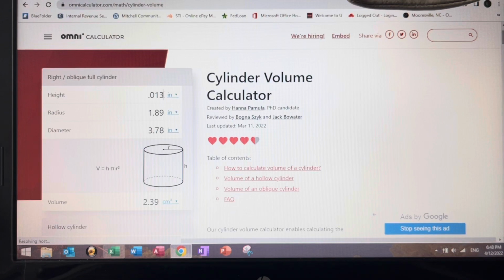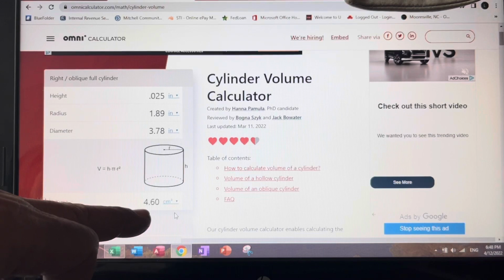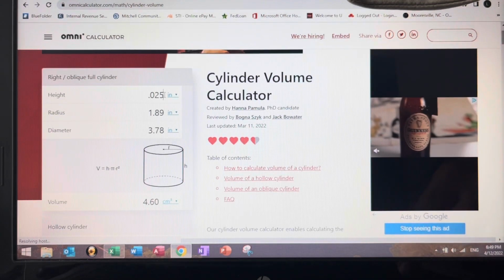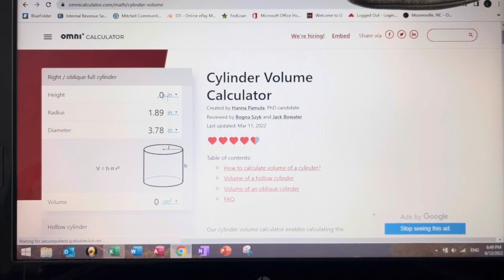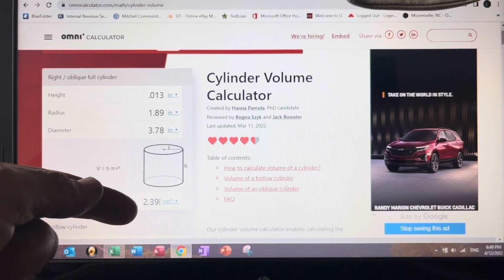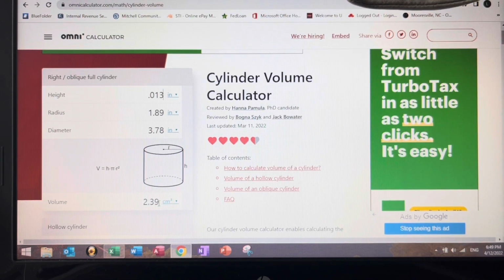Okay, so if we take, for example, the 26 thousandths, a height of a cylinder by the diameter, that's what we get in one cylinder, extra. 0.460 cubic centimeters. All right. Now, if we try the offset reversed, which is 13 thousandths, it's only 2.39, but remember, we're going to subtract this from the zero offset, and that will become the positive offset piston pin.